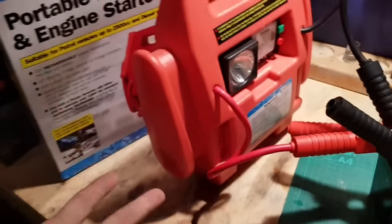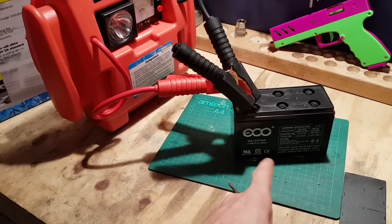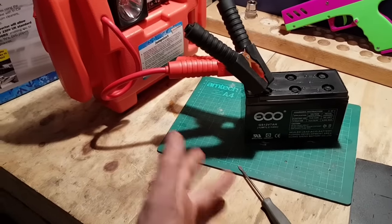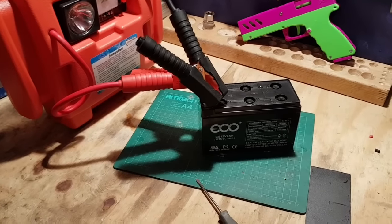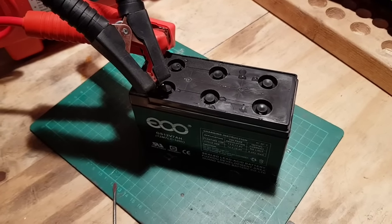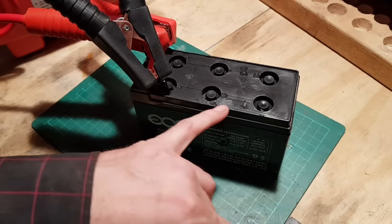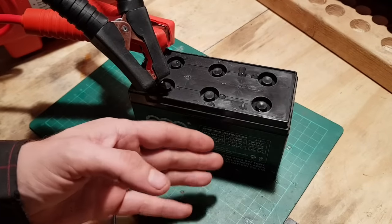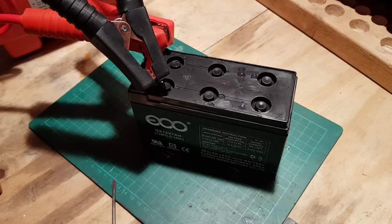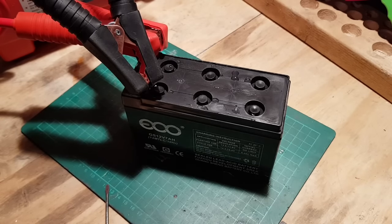This battery in the jump start kit is charged up to at least 13 volts, so it's going to sap energy into this battery. This is going to spike from 5.2 up to around maybe 11.3 volts. By that point it'll be way beyond the smart charger's warning detection, and as soon as we put the smart charger on it'll start charging back up. We'll have revived the battery — as easy as that. You could also use a trickle charger to latch on and get the amperage and volts up enough.